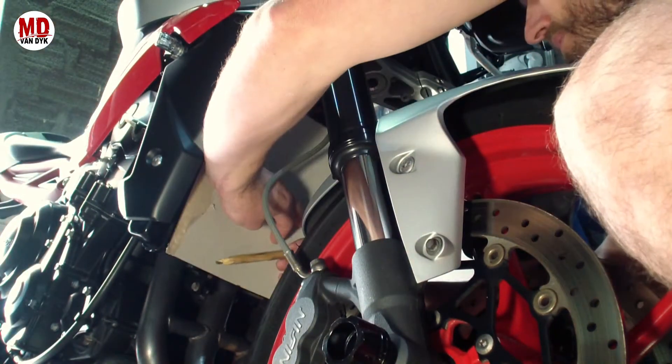The first panel is ready and it fits perfectly. It is a little bit long side to side so I'm going to trim it by about half a millimeter so it fits snugly and you don't have to force it in. I've marked out where the tabs need to go on this radiator guard. I'm going to cut maybe one to two centimeter thick support strips of cardboard, tape them to the main panel, start making brackets, see where they fit and line up, and then we are going to be test fitting, re-taping, re-cutting until they line up perfectly and are ready to be mounted. Then we can take this whole cardboard template and put it on top of the aluminum radiator guard and start cutting it out.